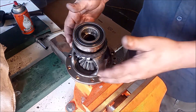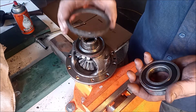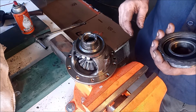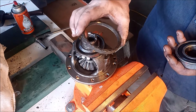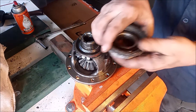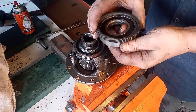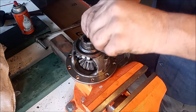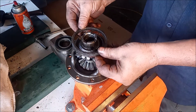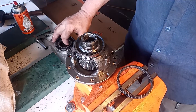Okay, so here's where we stand. This is our open differential, original from the transmission. We've removed one bearing and we've removed the speedo ring. We're going to be installing a limited slip differential into the transmission, so we're going to be putting new bearings on it and we will reuse this speedo ring. You might ask, why did we have to remove the bearing in order to remove the speedo ring? Here's the answer — the speedo ring would have never come off from underneath this bearing; the bearing had to come off first. Thanks for watching. Stay tuned for the coming episodes of this series on doing a case swap into an MR2 Spider.